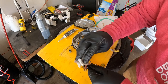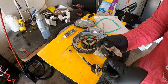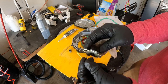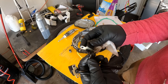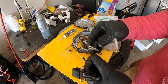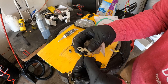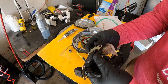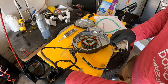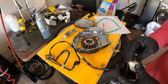A little bit of gasoline and a paper towel does the trick — and I just found a problem with why the bike wasn't charging. Look at that. That is crazy. So now I have to buy a set of these and I don't even know what they're called. I need to do some research. This wire right here was broken the whole time and I didn't even notice. It wasn't the stator — the stator was probably good. So we're putting this aside for now. I have to go buy a set of whatever these are — brushes or whatever they're called.